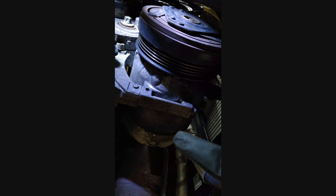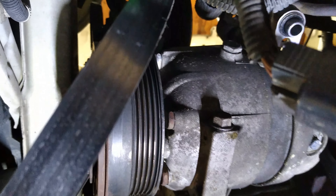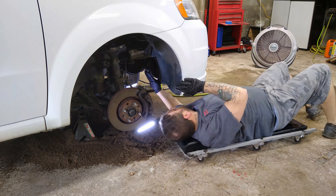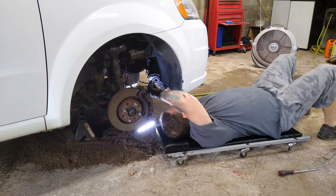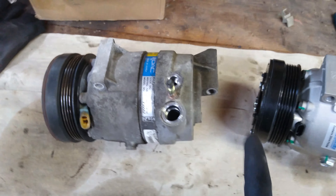Now we've got it vacuumed out and the belt off. Looking under here, there's one bolt there, another one over there, and one up top — this thing comes off pretty easy. Let's find out what size those bolts are. Right underneath there's one — it's a 12-millimeter. Right over on the side there's another 12-millimeter, and then there's going to be one up on the top as well.